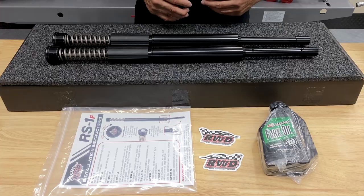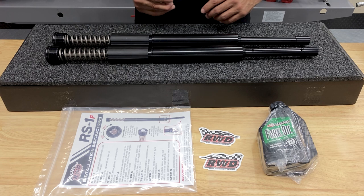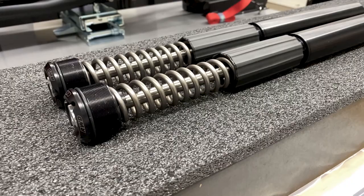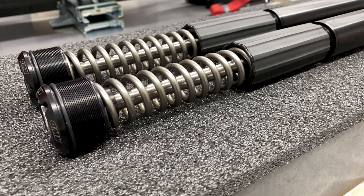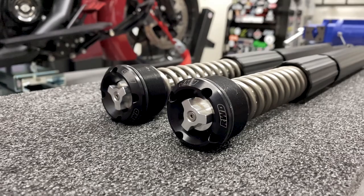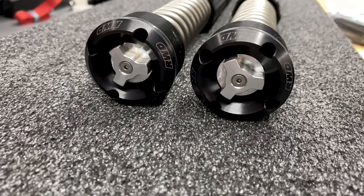So pretty simple, you get your two new cartridges, some new fork oil, and instructions. And for 17s and up, you're gonna reuse your stock drop spring. And for 14 to 16, they're gonna provide you with a spacer and new drop spring. So these cartridges come preset from the factory, so there's no adjusting your preload. All your adjustments are made on the top with these clickers, and they come set all the way to the left. And then from there, you can go and ride it, and then click it to the right to adjust